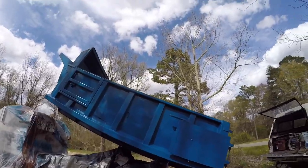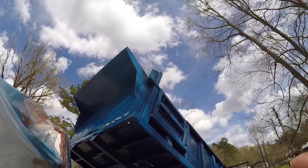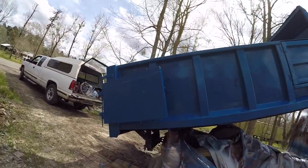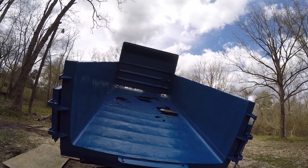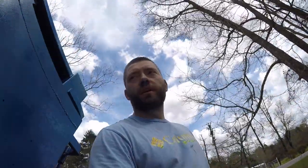So we're wrapping it up now. As you can see, a little paint in my nostrils — that's why you should definitely wear a respirator, especially if you're working with anything caustic. Check this out: here is our final color, here is our final paint job on the bed. It looks pretty decent. We're going to let this dry for at least three days — oil-based paint takes a while. We could have done more prep work and avoided some little ugly spots, but it's a dump truck. All in all I think it looks pretty dang good. Next thing we're going to do is get some two-by-tens and deck out the entire bed.